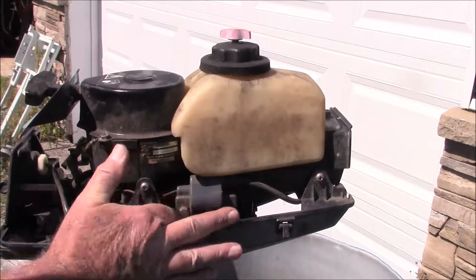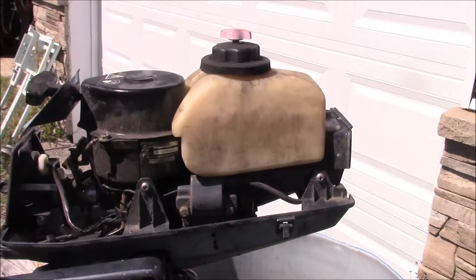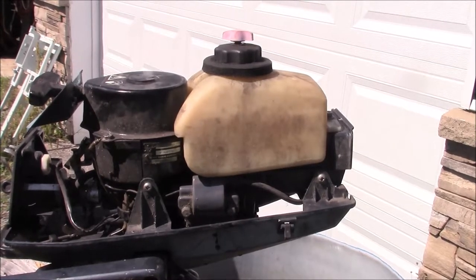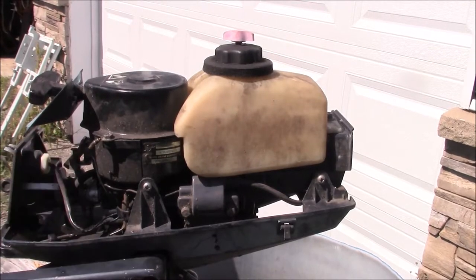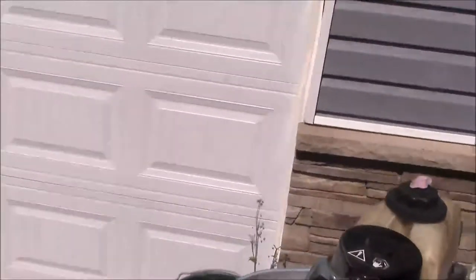There are several different versions of this motor. Some of them have a later CDI style ignition, of which this is one, and others have points. I actually prefer the points system because you can fix that - the CDI is ostensibly more reliable but if it dies you're spending $150 on parts. With points you can get in there and fix it with a file. For people who are not mechanically inclined, a CDI if it works is the way to go, but if you are mechanically inclined I'd go for the older one. This one has in my mind two potential issues.